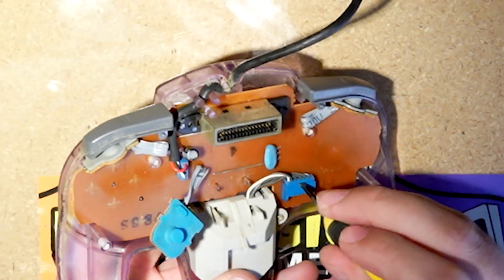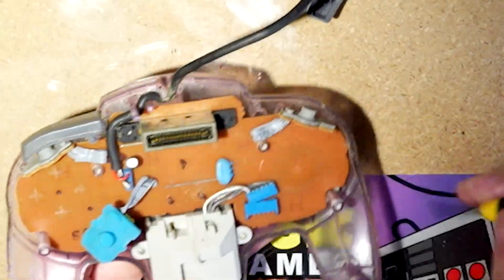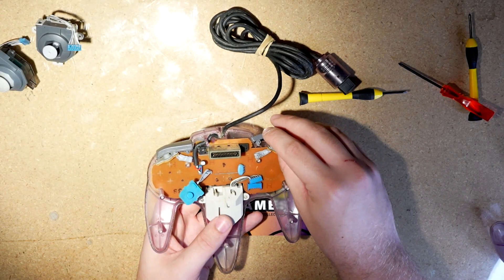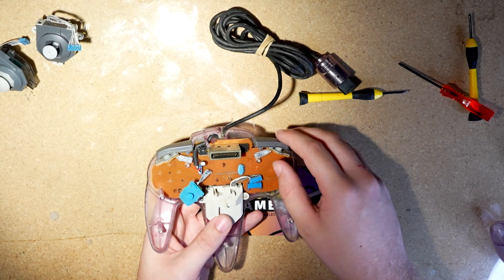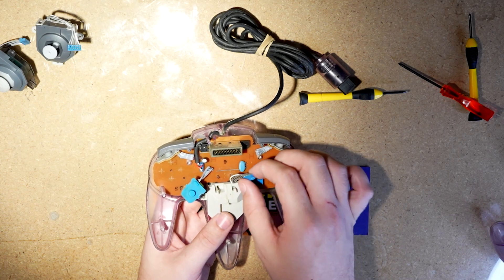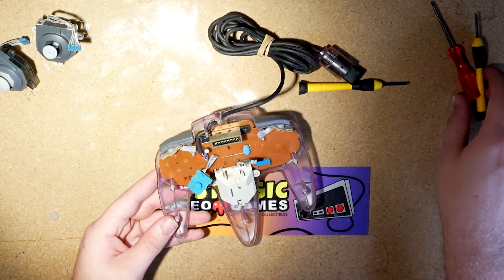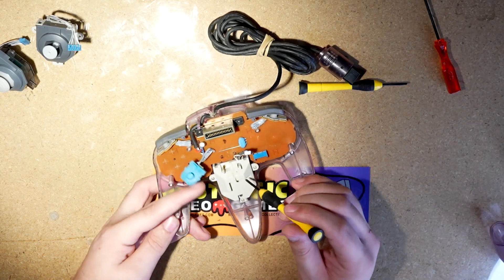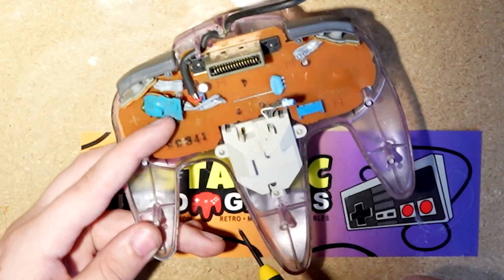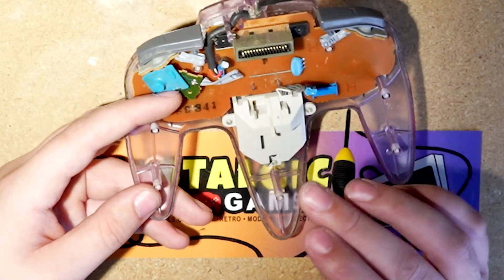My nails aren't strong enough, which means a little flathead screwdriver to the rescue. We just kind of gently pop that out. There goes the shoulder button — be careful not to lose the shoulder buttons because they are just sort of sitting in there on these little hinges. It's super easy to put back in, but you can knock them out real easy. There we go — unplugged from the motherboard. Now all we've got to do is unscrew these three screws here. They're the same size, same Phillips head as the screws in the memory card slot.